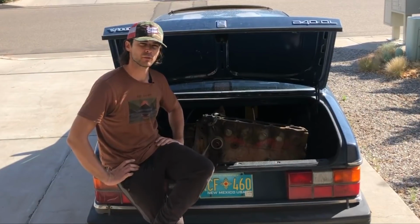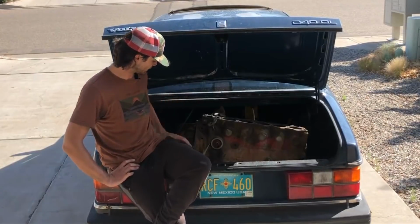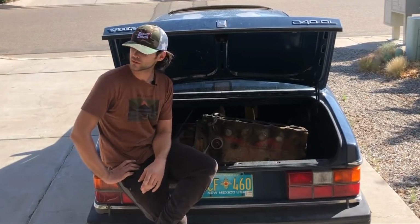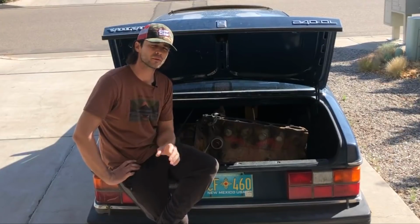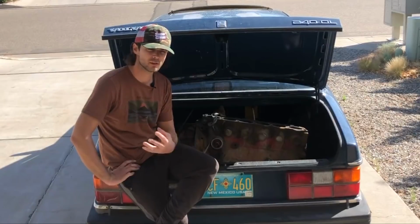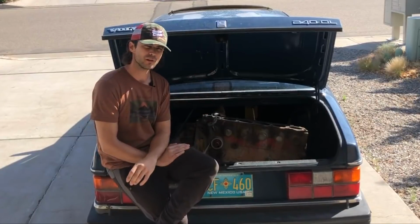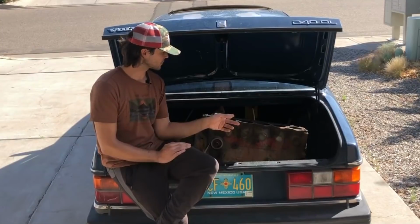I feel pretty good about going with the newer engine. I'm still dealing with a little bit of the challenge of finding an 8-bolt crank flywheel. The Laplanders, the C303s that use the B30 engine, seem to have 8-bolt flywheels, and with any luck, there won't be any differences in the way the clutch bolts up and the distance between the flex plate, the disc, and the flywheel. I think everything should be pretty straightforward. Fingers crossed on that. I need to pull the timing gears on these.